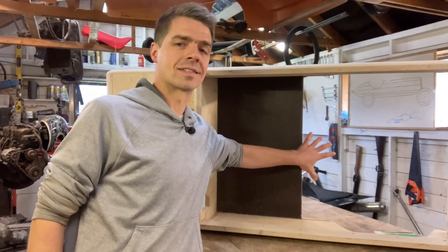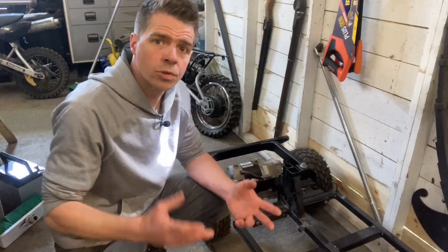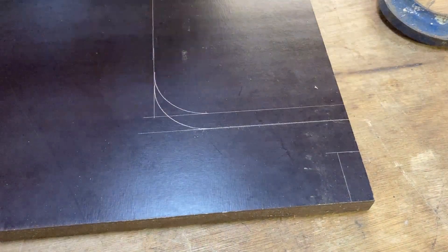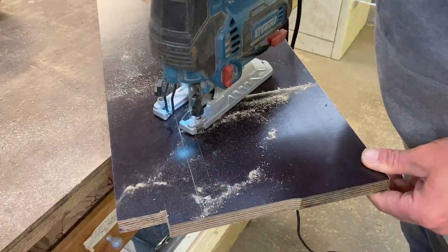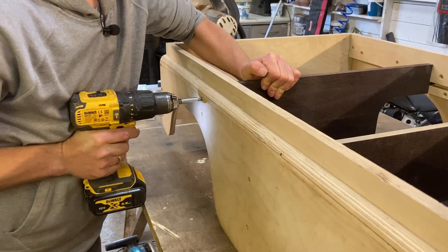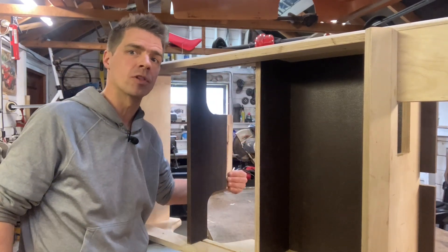The batteries are going to sit around about here underneath the seat, so I need an upright at the back of the base panel to form the front of the seat box. I also need an upright just here — this is going to form the front of the motor compartment, the rear of the battery compartment, and it's going to bolt onto the back of the battery tray to provide a vertical support for the rear of the body. Basically these two thin ends pick up the weight of the body at the sides, these cutouts go over the wheel arches, and this rebate on the back sits on the back of the battery tray.